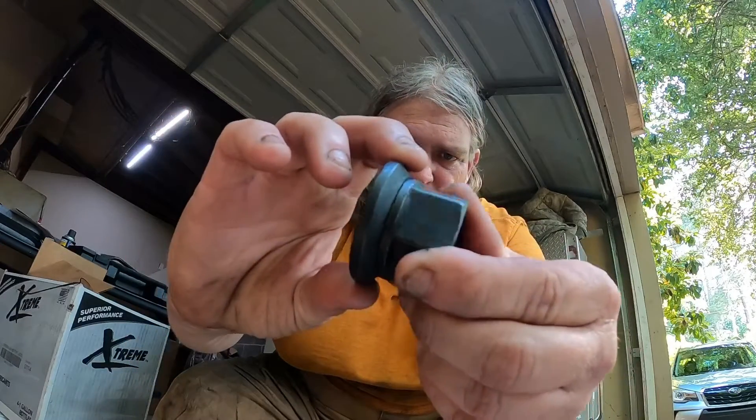I went to work on a dump truck once and the tire shop had cranked the lug nuts on so tight that when I went to do a brake job, every single stud on that wheel stripped out. They were running a 2,000 foot-pound gun rated for 90 PSI, but their air compressor was at 150 PSI — so that gun was putting out around 3,000 foot-pounds, way over torque. Another problem: these washers spin separately from the lug nut — you can see me spinning them independently — and they're designed that way.